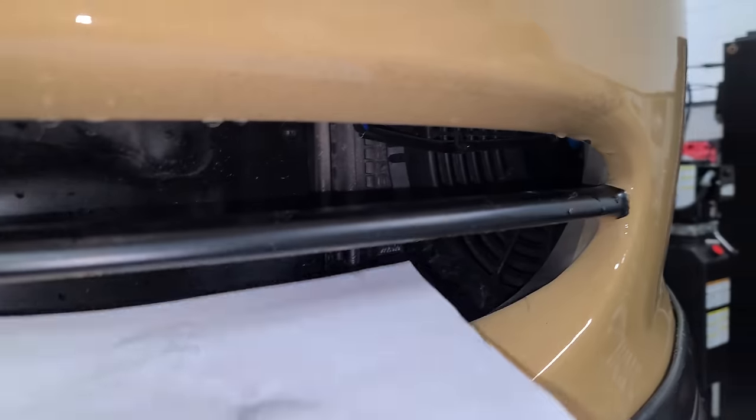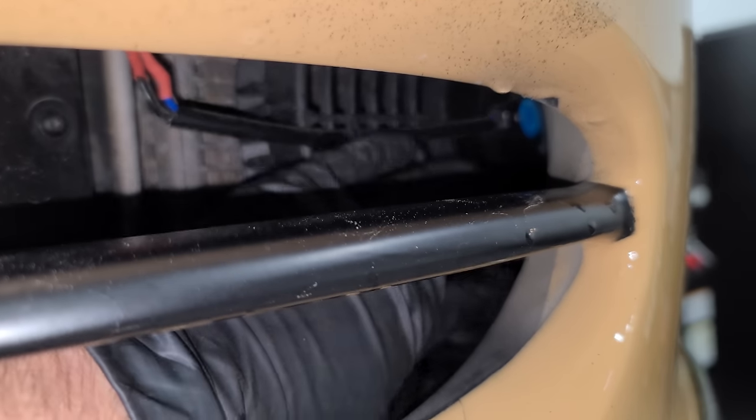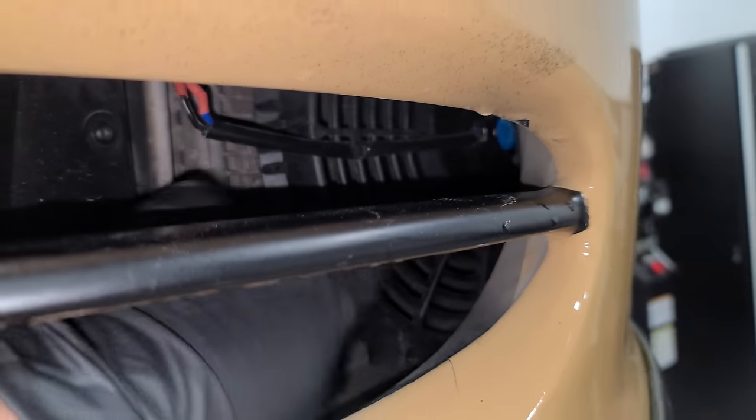And guys, these pusher fans, they aren't doing anything. They should be flowing air towards the back of the car. They don't suck in a piece of paper. Honestly, it feels like the air is just bouncing back the other way, or the fans are wired backwards. This is hurting the car. Guys, this is fantastic news. Pusher fans blocking factory fans with shrouds is not good at all. That could definitely cause this thing to overheat while you're cruising around the city.